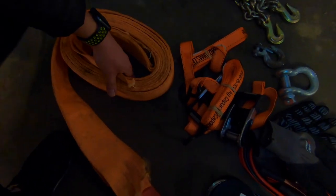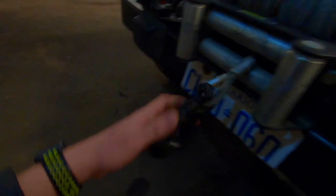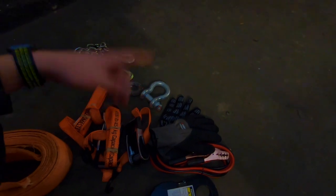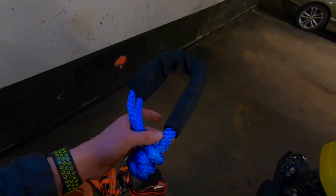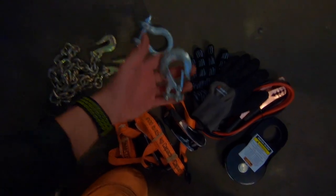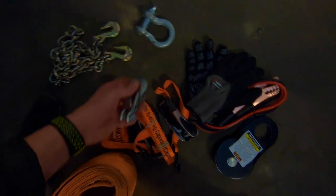Nothing that would actually cause an issue when snapping. Because when these are under tension, especially one of these, they have the tendency to snap back with all the energy that's in the rope or the line. And if there's anything on the end of it that's nice and heavy, that's going to come flying with it. So that's my number one point on why you guys want to get yourself some soft shackles. If something happens and this is connected to your winch line, this isn't going to come flying at your car or at you. It's soft — you can bend it. But a D-ring, even less than a pound, coming flying at you at speed — you do not want to experience that. Trust me.